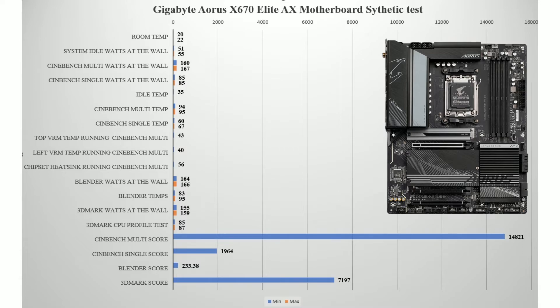The board is well built. The next version up — the Master — is around £200 extra, comes with more features, and I think it's an 80-amp board versus the 70-amp on this one. For basic non-overclocking use — or even some overclocking — you've only got 70 amps to play with here, and the top-range board goes up to about 100 amps, but you're paying seven to eight hundred pounds for that. For non-overclocking, the board is stable with no problems. Don't forget to update the BIOS — I couldn't get 6000MHz memory to run stable until I updated to the latest BIOS version.